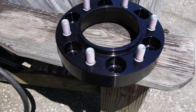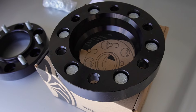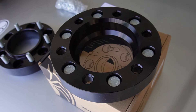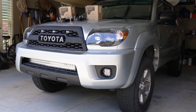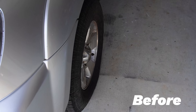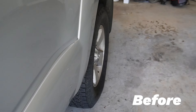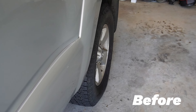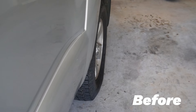These are one of the most popular wheel spacer options on the market, with SpyderTrax being a pretty well-known brand, and that's exactly why I decided to go with these even though they were a little bit more expensive. I'm putting these on my 4Runner in preparation for fitting 285 tires. Looking at the before — the wheels are a 30 millimeter offset, which puts them right inside the fender, and I'm hoping to push them out to be about even with the fender.